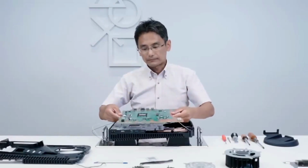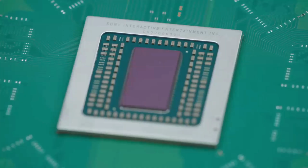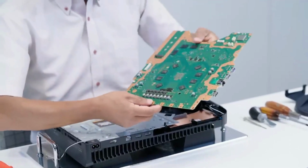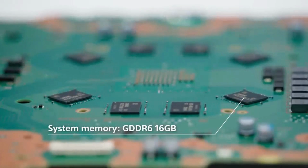However, PlayStation may have a bigger issue they now have to deal with. According to multiple PlayStation 5 repair shops, the console's liquid metal used to cool the console has been discovered to spill and potentially become uneven, which in the case of the PlayStation 5's accelerated processing unit, this liquid is designed to cool down the actual APU. An improper or uneven coverage of that liquid could lead to overheating, high energy consumption, unexpected power down cycles, and of course, noisy fans. Which I guess I gotta be the guy to say it, but at this point, noisy fans just seem like it's part of PlayStation's MO.